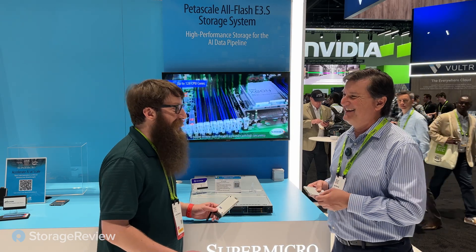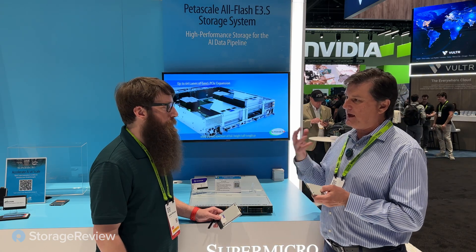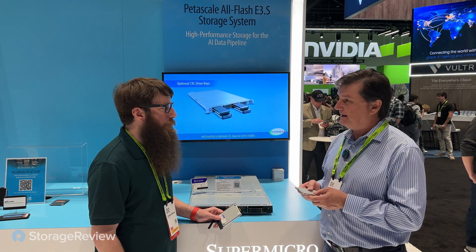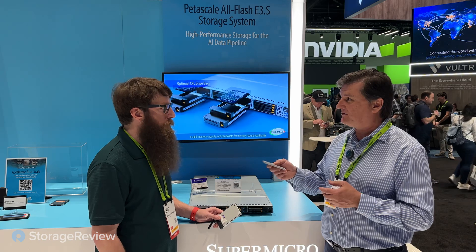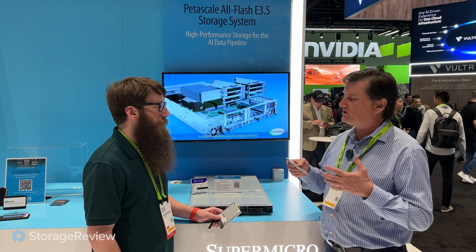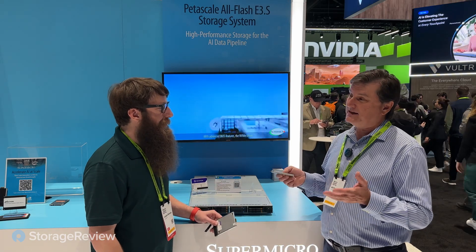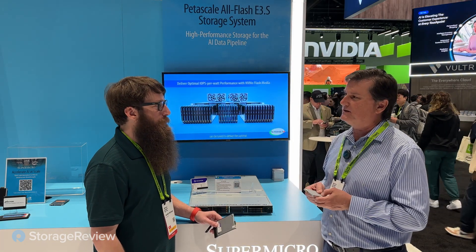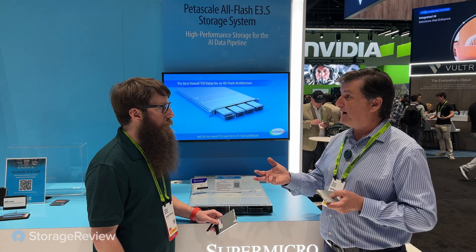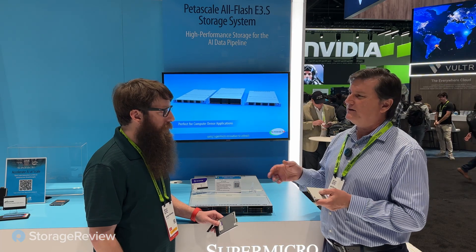And sustainability — I've done some pretty mean things to your drives and I haven't killed one yet. Sustainability and reliability are really important. You need product reliability in the drive, which we do have. We have world-class leading silent data corruption capability that we've tested at Lawrence Livermore Labs. Silent data corruption is beneficial because you don't want bit flips in your SRAM — cosmic rays and things like that affecting your AI. We've not only tested that, but measured it synthetically. You need that reliability, that sustainability — Uber down to 1 in 10 to the minus 17. When you compare that to other products out there, even HDDs, you don't necessarily get that equivalency. Moving into AI, you need these kinds of reliability and durability, especially as it disseminates out to all aspects of our lives.